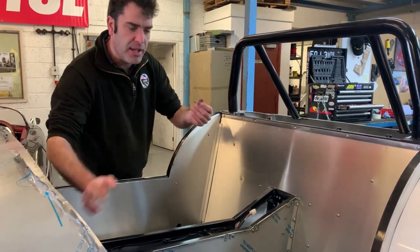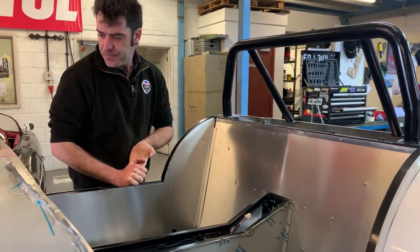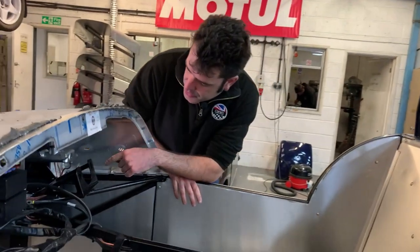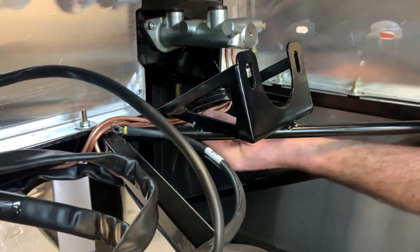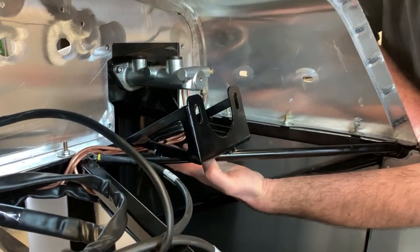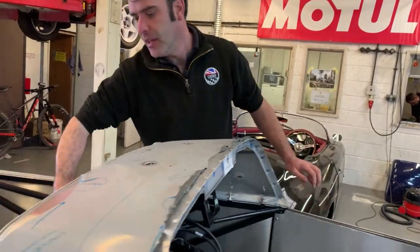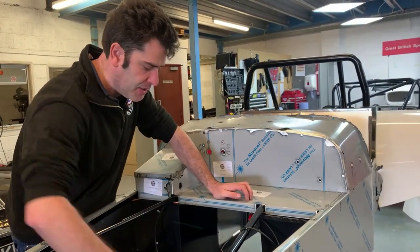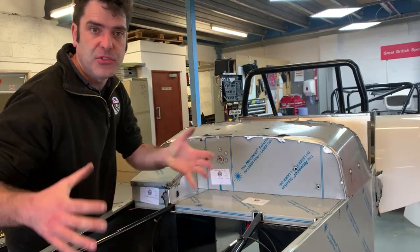If it's going over an edge, make sure you've got clearance. Nip all the brake pipes up as you go and make sure everything's clipped up and secure. One other point: on the front here, just put the brake lines coming through on the back edge of the box section — you don't want them on the underside where there's a potential way you could scuff or wear them with your feet. And that's the same for the brake line that goes across to the left-hand side. Don't run it on that box section where, if you put the engine in, there's a possibility of crushing it. Run it further back so there's no chance of crushing it when installing the engine.